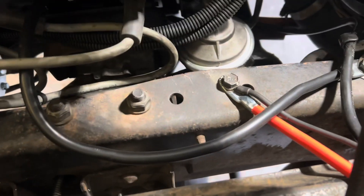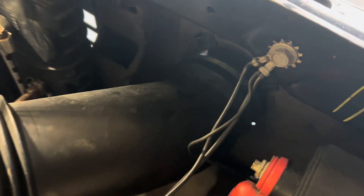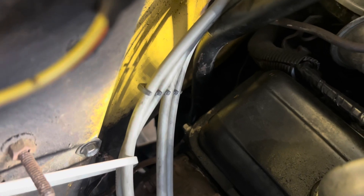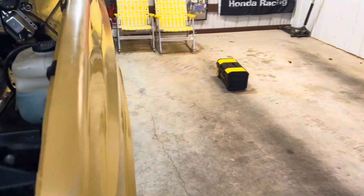So I added a cable from the engine to the frame and put a new ground cable on the battery. I took the associated ground points that were already there, sanded them, and cleaned them up. There's a factory ground strap on the back of the engine that goes to the firewall — I took that off, scuffed it up, got down to bare metal, cleaned it up, and then put another small ground strap on.